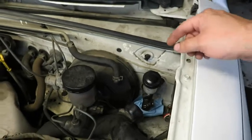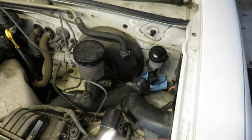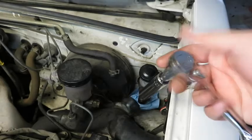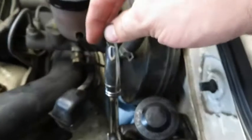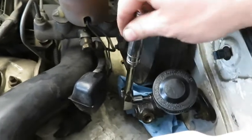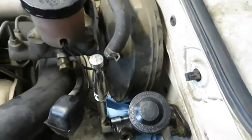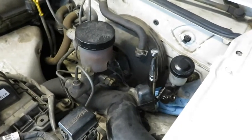Finally, we can turn our attention to the master cylinder here, and I just wanted to show you the setup that I have here. I've got a deep well 12mm, a 1-inch extension, and a 3/8 ratchet. I want to show you how well this fits here, and then I'll put the camera back on the tripod. But you can see it's a perfect fit for that side as well as the side here. So I'll put a link in the description for this basic setup. We'll go ahead and remove the master cylinder.